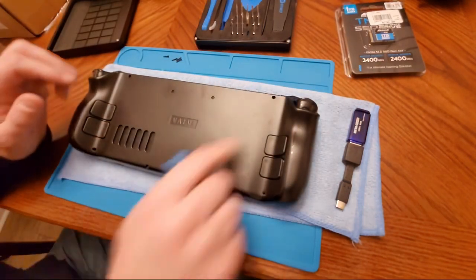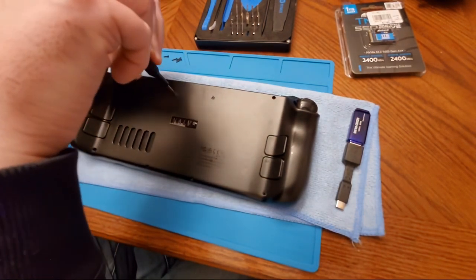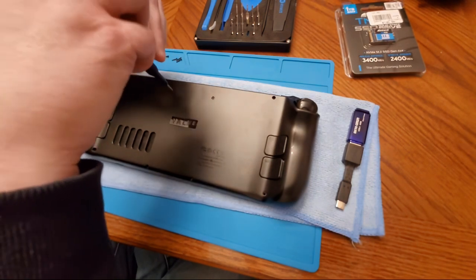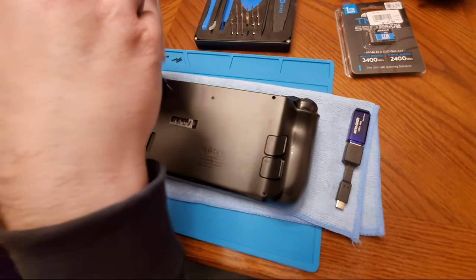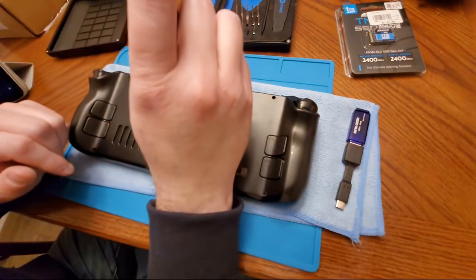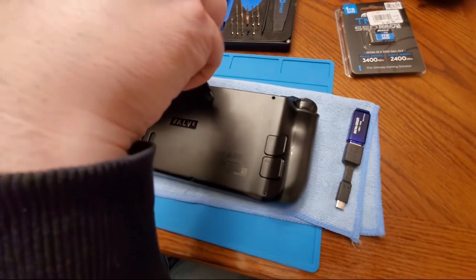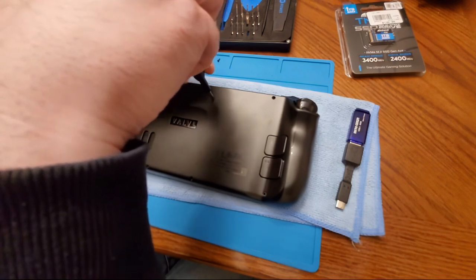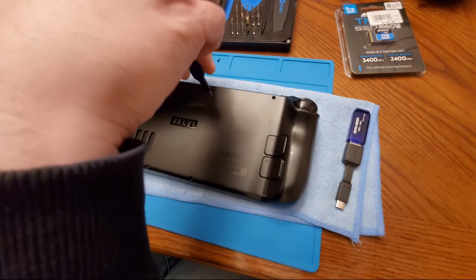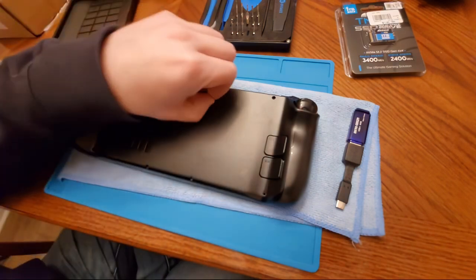Okay, we've got the outer four out, now we're going to work on the middle four. If you are doing this for the first time and you have a micro SD installed, please do not forget to remove the micro SD from the bottom of your unit. When you take it apart there is a good chance you will split it in half, which is what I've seen a few YouTubers do. I have a 512 and I really wouldn't want to snap that in half.